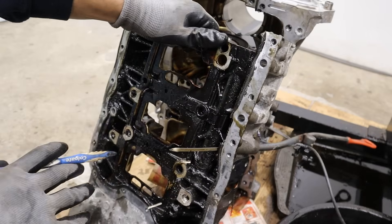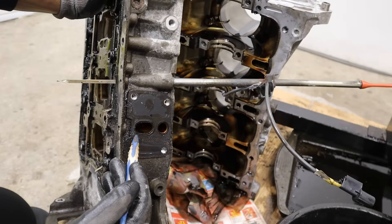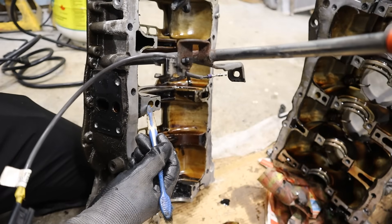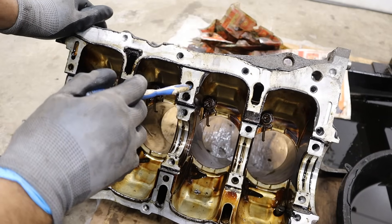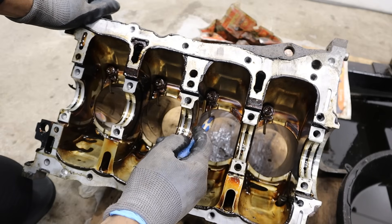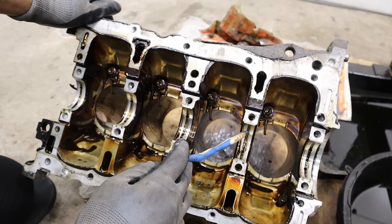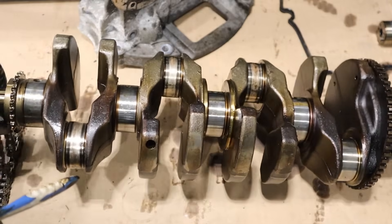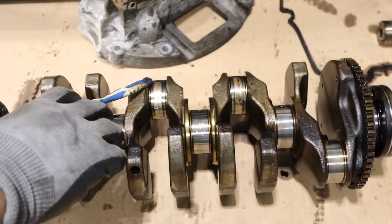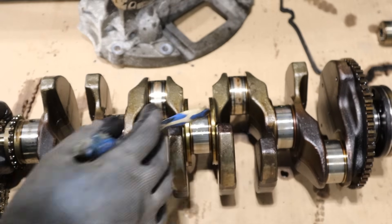Looking at the oil lubrication system, the giant oil pump mechanism sucks oil in through the pickup tube, sends it to the filter to get filtered and cooled, then sends it back into the engine. That filtered oil is sent through a galley into the block, down into the main oil galley running along the length of the block, where oil sprayers tap off to lubricate the cylinder walls. The main crankshaft bearings also tap off of it, and that oil then goes to lubricate the connecting rod bearings. The crankshaft has a cross drill that goes from the main bearing over to the connecting rod, and that's where you can see a lot of damage — indicating this engine was either run low on oil or run with debris in the oil.